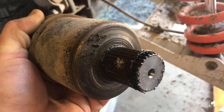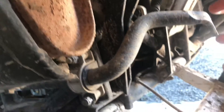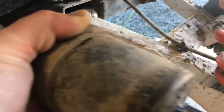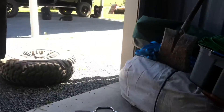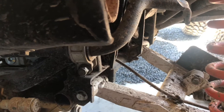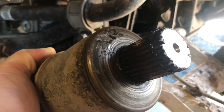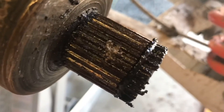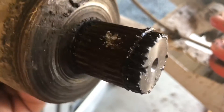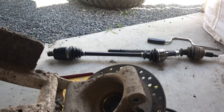For those guys that do a lot of water riding, if you've broken it up here like I have and you don't want to take the exhaust off and take everything else off, you could put a ratchet strap around this and go across to a post or something in your shed and crank a little bit of pressure on it, then get a pry bar and a hammer and belt it across — I think you might be in luck to get it out. You just need that constant pressure against the little circlip to make it slide out. Mine's out, so I'm going to go ahead and put the new one in.